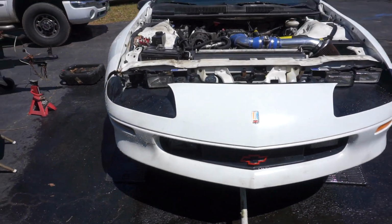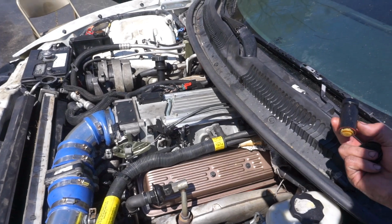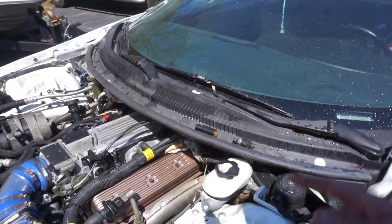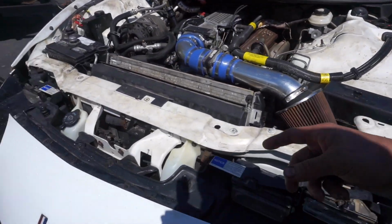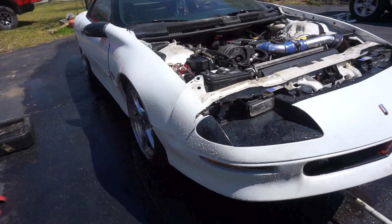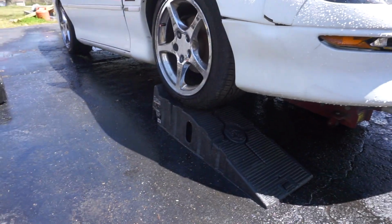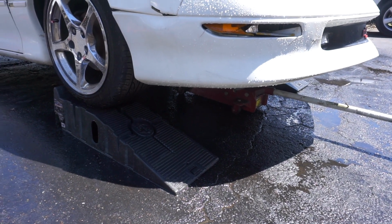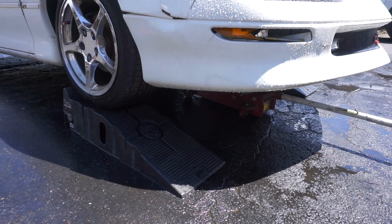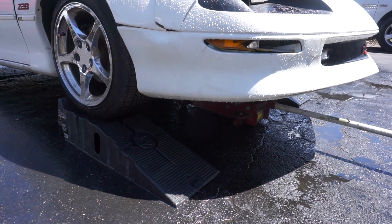All right, so got it pushed out. Got all the headers tightened up. Had to replace, I believe this is the oil level sensor. It was pegged out, it was reading zero, plus the back piece of it was broke off, so it was just shooting oil out everywhere. Might have to adjust the rocker arms, but my exhaust tube was extremely loose, so I went ahead and tightened all those bolts, cleaned everything up on the bottom. Careful not to spray the OptiSpark. Like I said, it had that bad oil leak. The seal on the oil filter that was on there was busted as well. We got it replaced, so now I'm just going to add some oil and keep my fingers crossed.